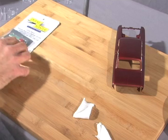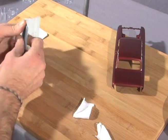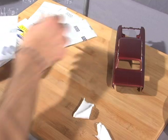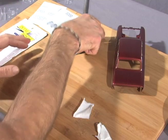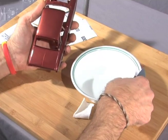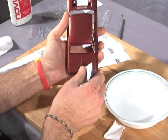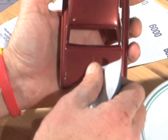First things first — we want to pull this out. Being that this is almost right on the top of the surface, we've got the 12000, 8000, 6000, and 4000. I'm going to set the 3200 and 3600 aside because I don't really need them — it's very close to the surface. I want to take the bowl of water, dip the paper, and just very lightly go right over it. Naturally it's right on a high spot, so you have to be very careful — you can burn through in half a heartbeat. Whenever you're wet sanding, always go lightly.